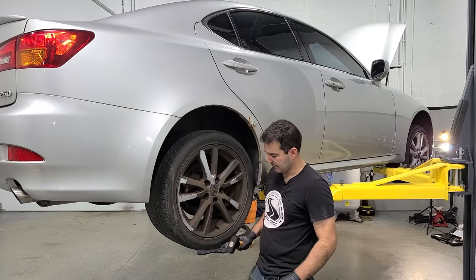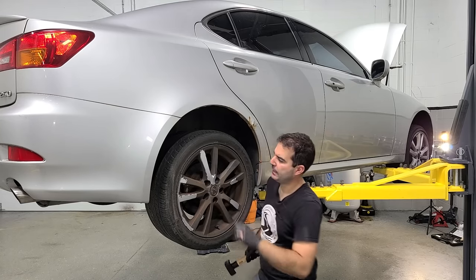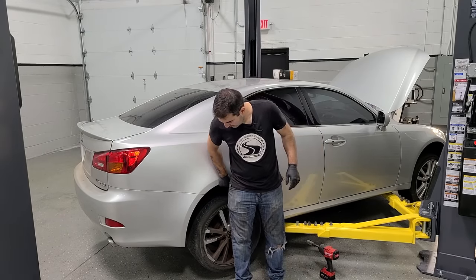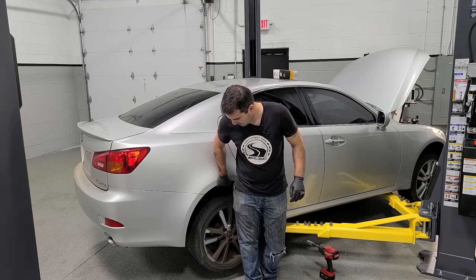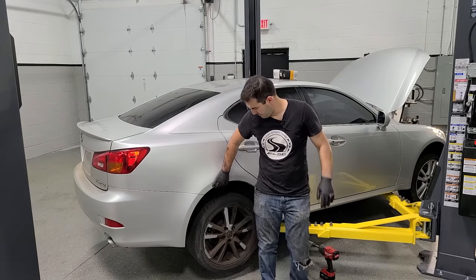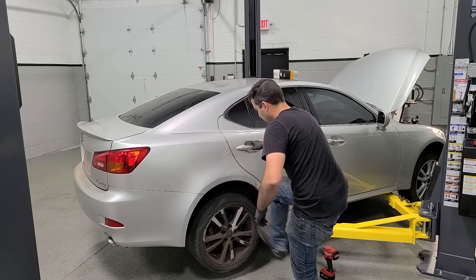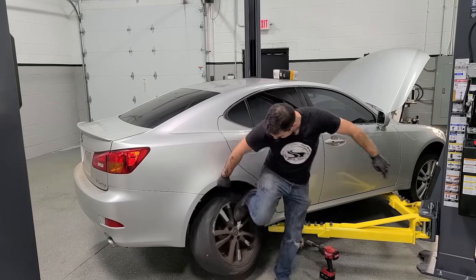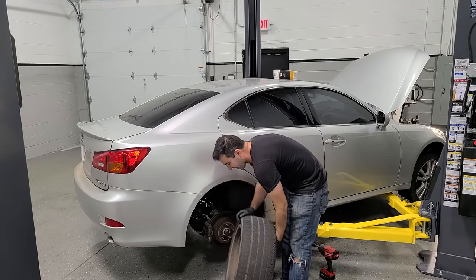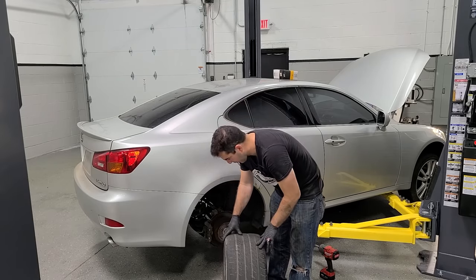Okay, so we're gonna hit it on the inside tire and probably hit the rim a little bit. Gotta do the old mule kick. So when I was a dealer tech for Mercedes-Benz, I also did roadside assistance. So I've changed like thousands of flat tires and this always works. Watch. Every time. Are you kidding me? This always works. Gotta just hit it at the top. Yeah, see, I told you. You didn't think it was gonna happen, did you? It always works, and you don't mess up the wheel because you're using the bottom of your foot, I mean your shoe. So wow, these tires are really, really bad.